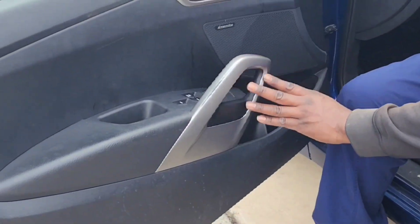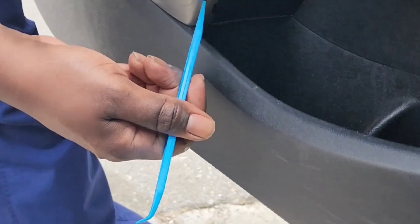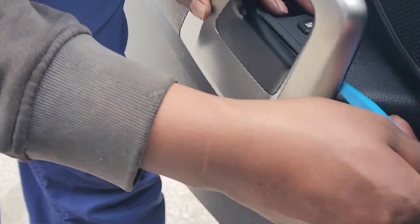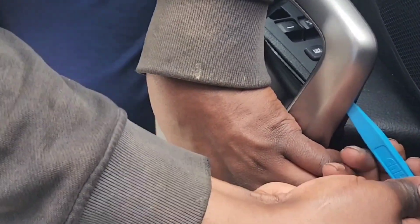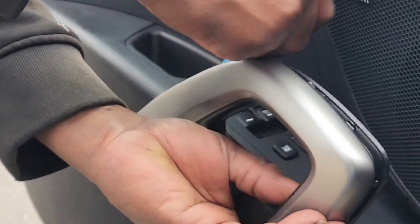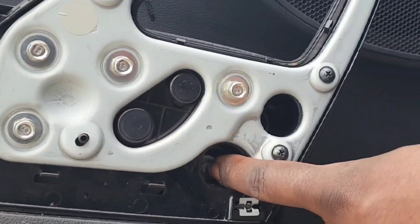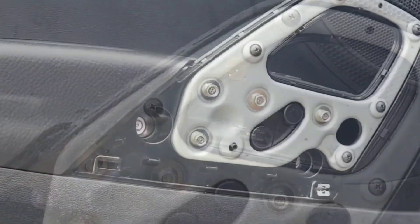This handle right here will come off. It has a little square hole in it — you're going to stick your fishbone or flat head screwdriver in it, pull up on it like this, and then work your way all the way up. Pull this whole thing off just like that. This portion right here has three 10 millimeter screws — one, two, three. That's what holds this handle to the frame of the door, so you're going to take those out.